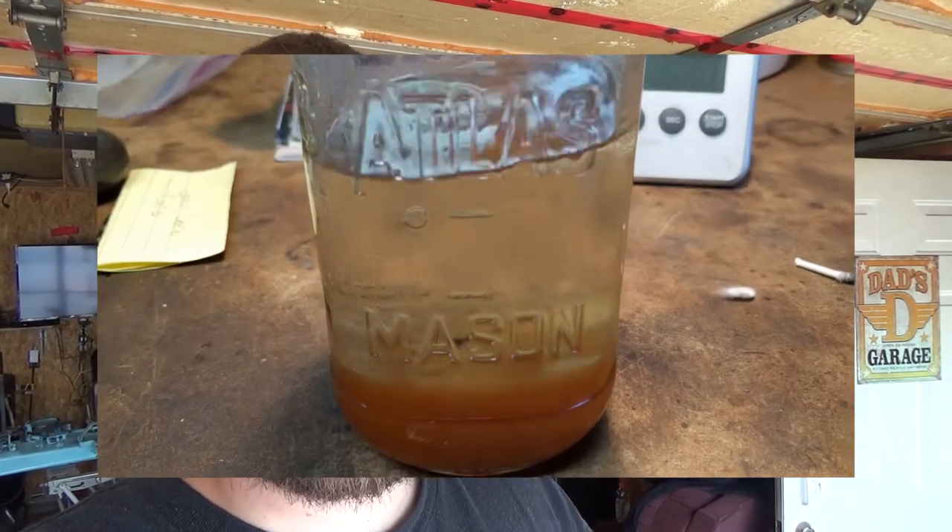Next up we look at a Honda pressure washer that my good friend Floyd over at Tire Trackers uses to wash his vehicles. Even though he stores this machine indoors, the jerry can that he filled it up with ended up sitting outside. So without knowing there was water in his jerry can, he filled up the fuel tank on this Honda pressure washer and tried starting it up. If we look at this clip we can see fresh clear premium fuel on top and rusty water down on the bottom of this mason jar. Because Honda primarily uses metal fuel tanks, I was forced to use CLR — calcium lime rust cleaner — to clean the inside of that fuel tank, because the water from the jerry can ended up creating rust which completely mixed in with the fuel.